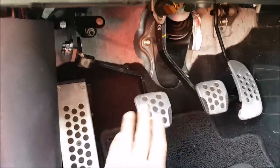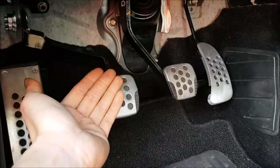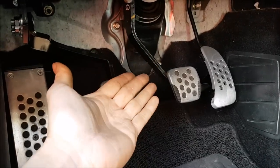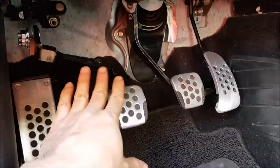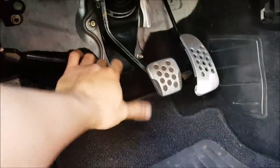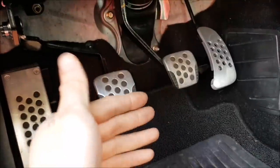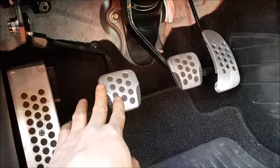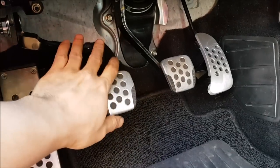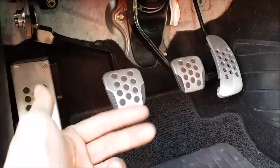The cheapest fix is to just not push in the clutch as far — you don't need to. If you want to do it properly, you buy this new assembly, which changes the ratio of everything, and it's fully adjustable so you can adjust the pedal all the way up or down depending on your driving style. In the factory setting, you get full motion on the pedal but you're not overextending the master and slave. That's the key point — that's why this makes it last longer and corrects a lot of the issues.